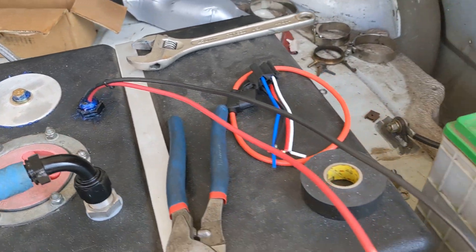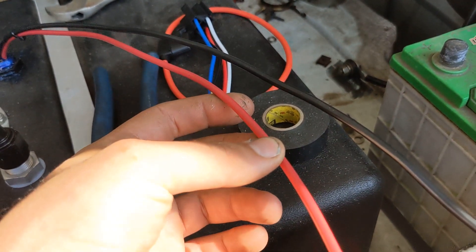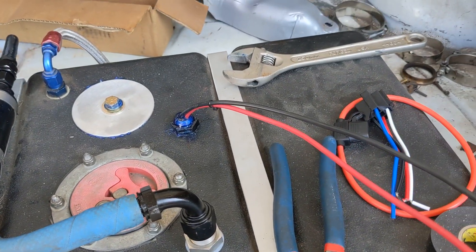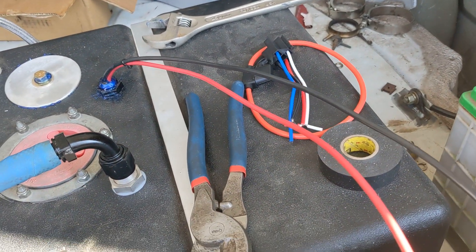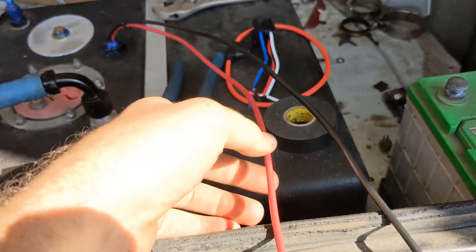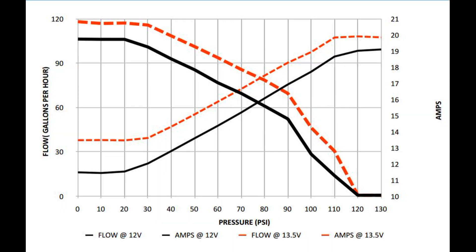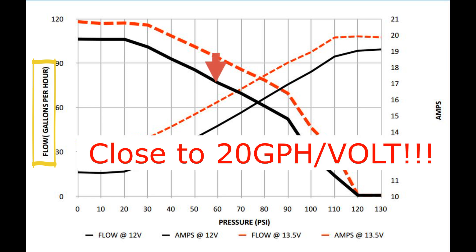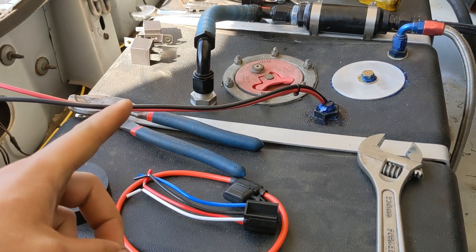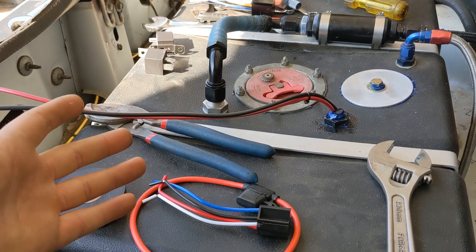Now that you have the wiring out of the fuel tank, I recommend running good heavy-gauge wiring. This is 10-gauge — I know the wires coming off the fuel pump are not that big, but we always run way overkill on the fuel pump just because it's so important. Any voltage drop across your wires results in less fuel flow. If you look at the fuel pump curves, which I'll put on screen, you can see how drastically flow decreases with voltage, because the speed of the pump is directly correlated to the battery voltage it receives.